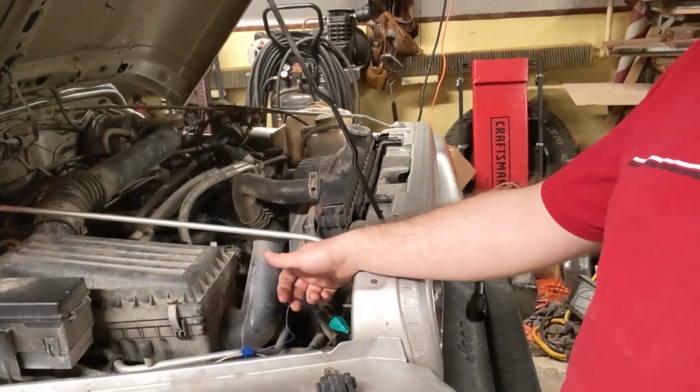On this side, the driver's side, I used a spade connector plugged right into the harness on the ATC. Everything's cool. On the passenger side, I gave myself a lot more aggravation by cutting off the factory female spade connector that ATC includes with the light, and soldering this extension lead on. I initially did that because, one, I didn't think I had any spade connectors handy, and I didn't want to run out to the store to buy any. And two, I thought it would just hold up better because it's a more positive connection with soldering.